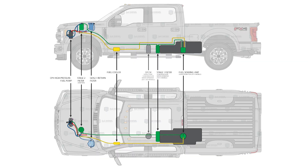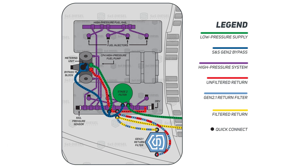You did the best thing that was available for a lot of years. Several years ago, we developed the CP4 bypass kit — or the disaster prevention kit, as it's usually dubbed. That still leaves the original CP4 in place, but it changes the fuel flow paths so it blocks debris from being able to contaminate the rest of the system. The pump might go down, but at least it doesn't take everybody else down with it, saving you several thousand dollars in unnecessary repair bills.